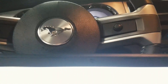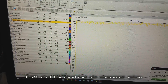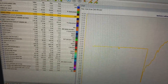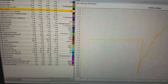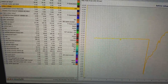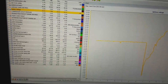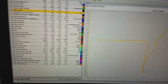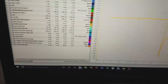It didn't trip — still good, it's not tripped. Let me try to shut it off. Still got power... there it goes — that was while cranking. That was a whole new correlation: the voltage drop is happening while cranking. It's so bad, I don't understand this. Yeah, it's dead — I watched it click.